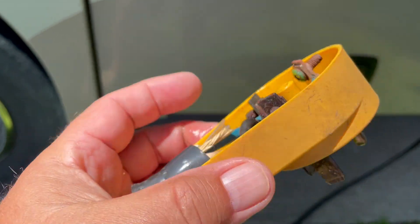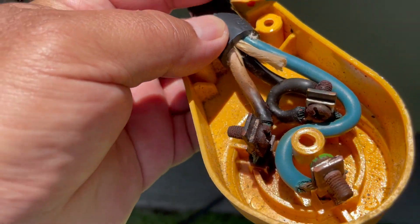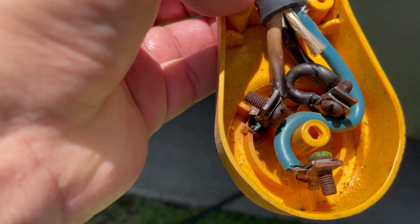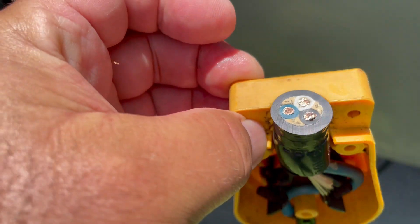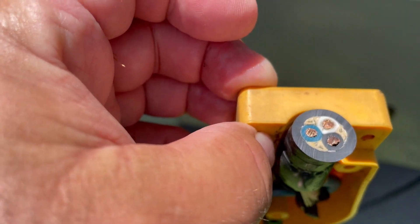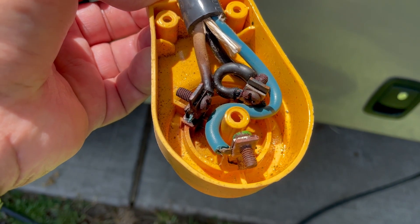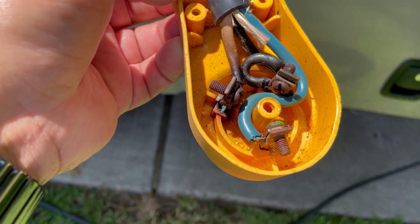We did clean it up for that particular show by taking a wire brush and cleaning things out. But you always want to check the inside. You'll notice there's some discoloration on the actual cord — the one on the left by my thumb is actually the white wire, but you notice it's actually black. You also see some corrosion in there. When you see that, the best thing to do is cut it off. What I'm looking for is nice copper that's not burnt. If it's burnt, I'll cut back a little further. If it's burnt all the way through, it's time to replace the cord itself. But I found nice copper back here.